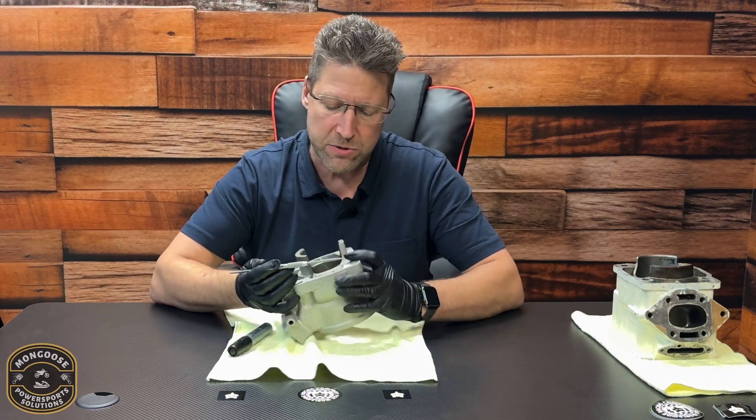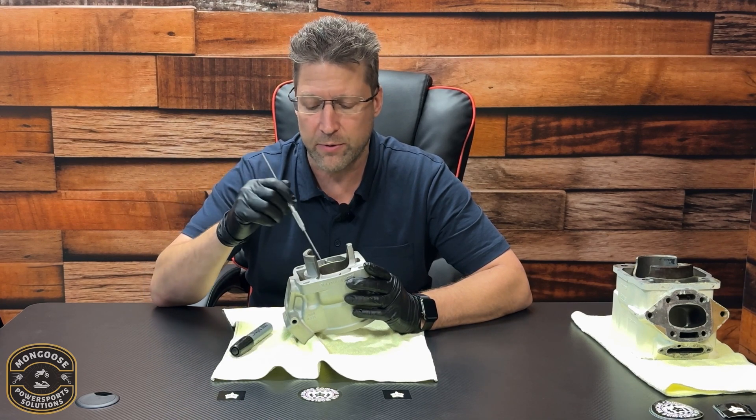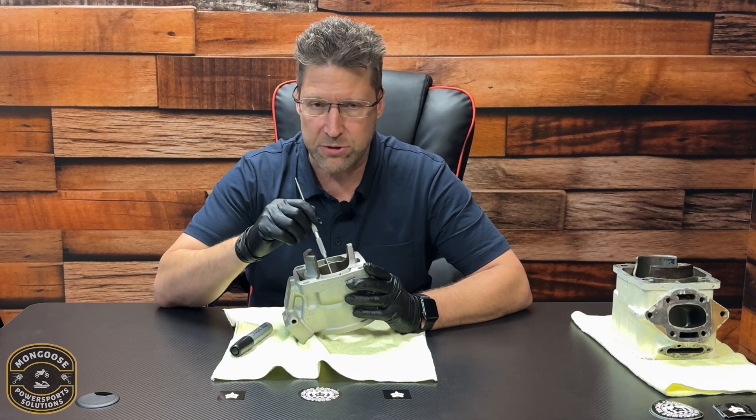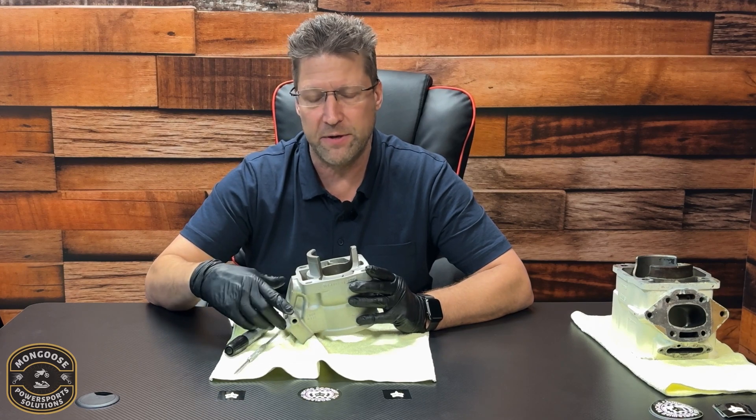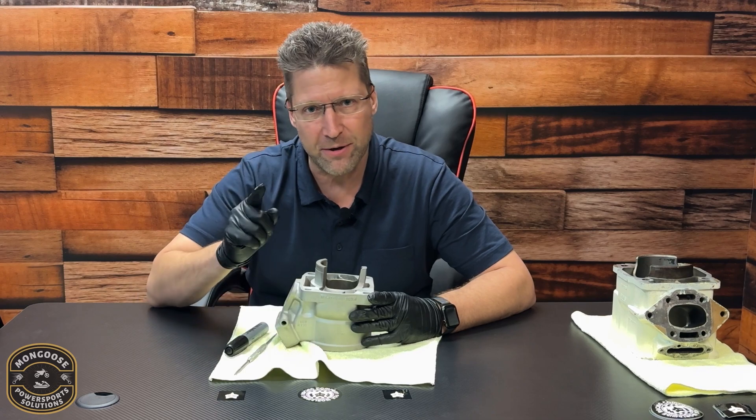People say the rings go by it — but a ring going by a little dent that's holding oil will actually dip into that oil and lubricate the skirt and the rings. It will actually have zero effect on performance. A lot of people do not believe this, but we know from experience, and I'm going to show you on the next video.